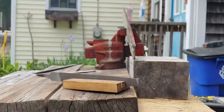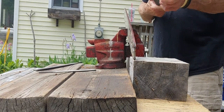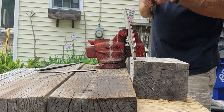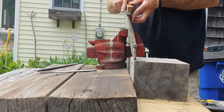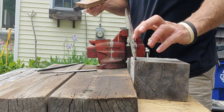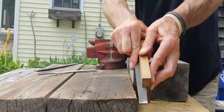I'm going to stone the bar too and show you how to do that. When you go down you can see if it's cleaning off the rails evenly, and you'll be able to see if you have low spots. I still have a little bit of a low spot right here and a little bit of a low spot right here, but they only have to be close — they don't have to be dead perfect. I'm not trying to return it to brand new, this is just general maintenance on the bar.